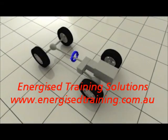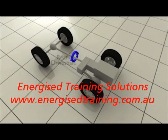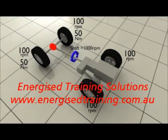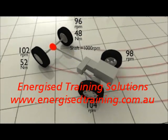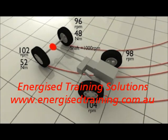A conventional part-time 4WD vehicle being driven in 2WD supplies power from the engine to the rear wheels via the rear driveshaft. The rear differential allows each wheel to receive differing amounts of torque based on driving conditions. When driving in a straight line on hard bitumen, both wheels receive 50% of total torque. When turning, the outside wheel must travel a longer path, which means the torque required between wheels must be different to allow the outside wheel to turn at a faster rate.